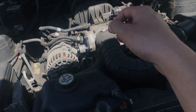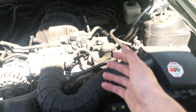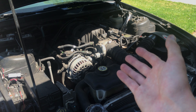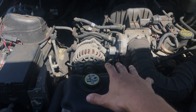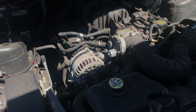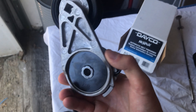When you're removing the belt, that's the first step in taking out any of these pulleys. So if you wanted to replace your alternator — the power steering pulley's in there as well — the first step in doing any of that is taking off the belt. I'll show you guys once it's off.